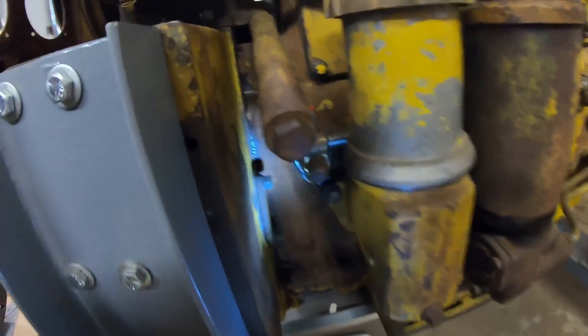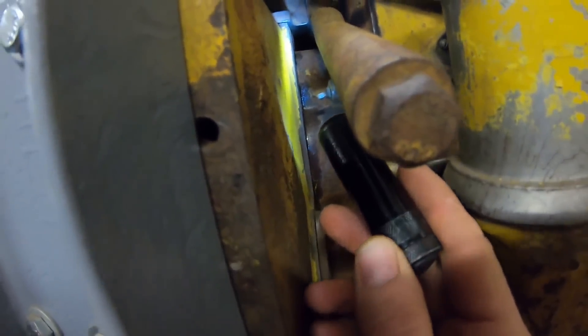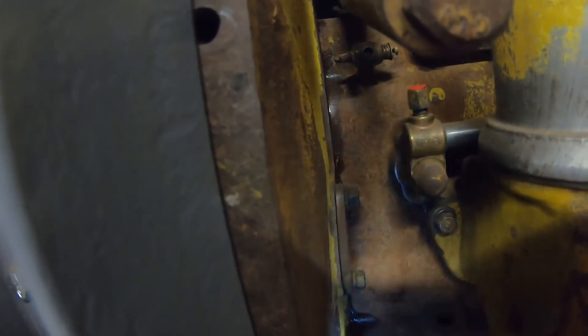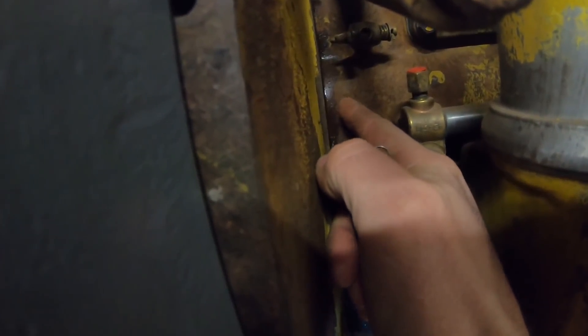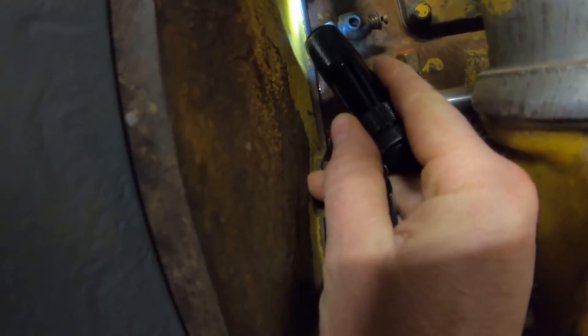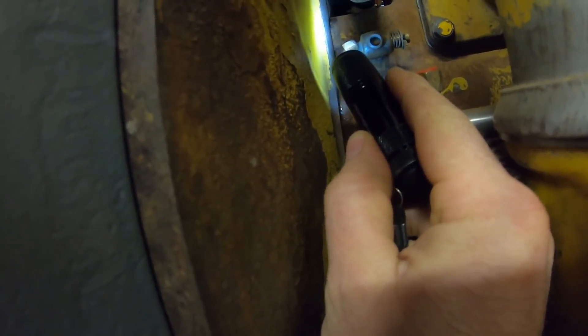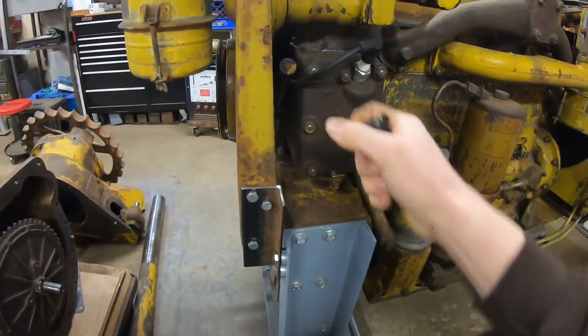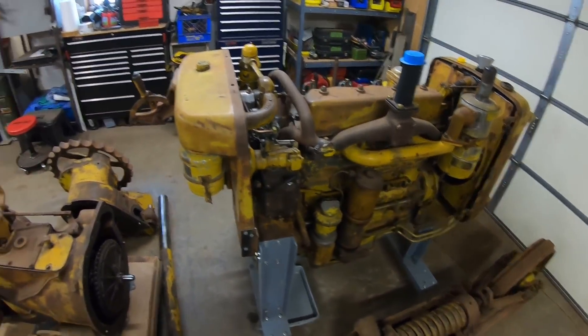A trail developing over here. We look up to the base up in there and you can see it coming down. Two possibilities — the more horrifying one would be that O-ring seal between the engine block and the bell housing. Thankfully it's coming from — I don't know if you're going to pick it up on camera — what's coming from up here at the starting engine base gasket. So the engine's coming back off.